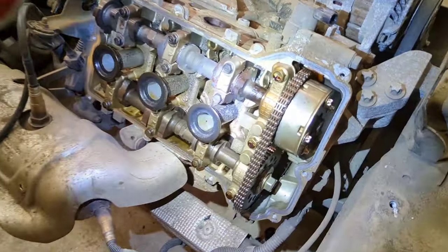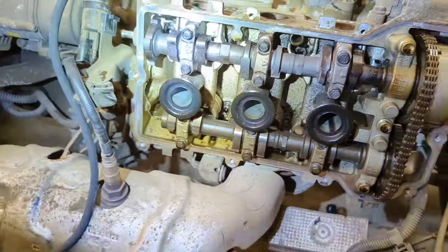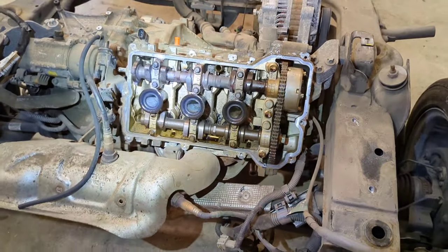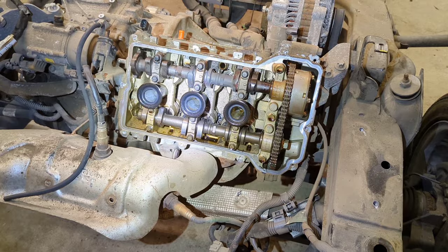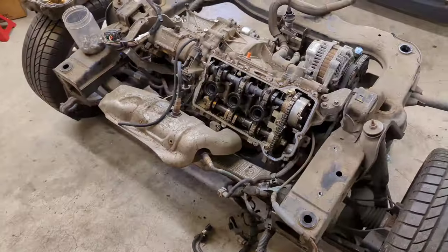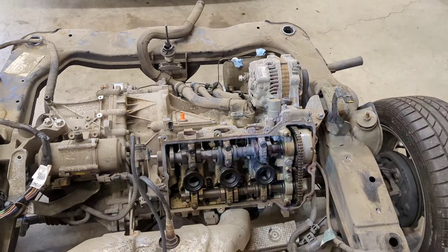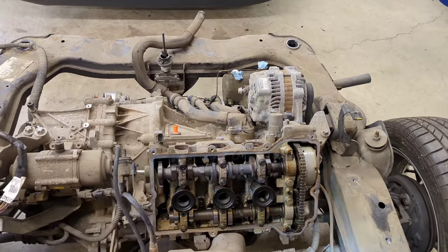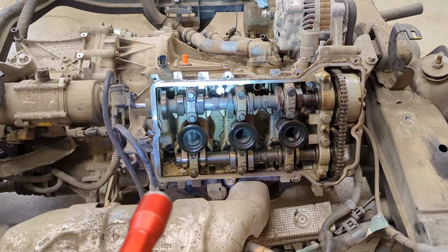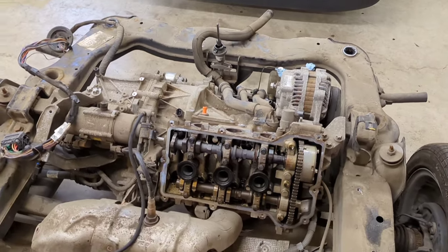All that little stuff in there is metal, and there are chunks down there too. I was told when I bought this car — I asked very specifically — if I put a new head gasket in it, will it run and drive? And he said yes. That is not true. So at this point I'm going to continue disassembling this engine purely for fun. I want to see what happened. I'm assuming it lost oil pressure and the bottom cam was floating around, while the upper cam ran dry. My disassembly will be more destructive because this engine is not going back in anything.